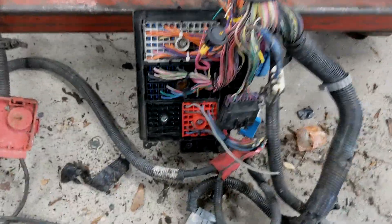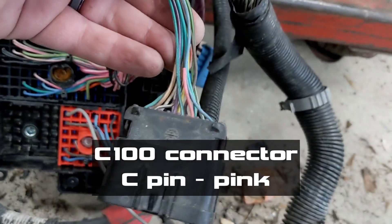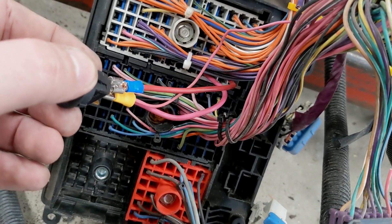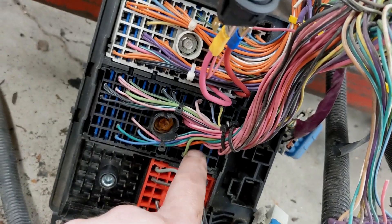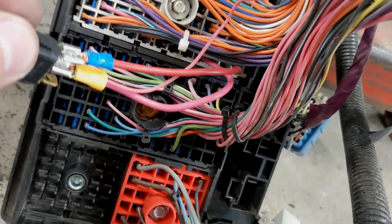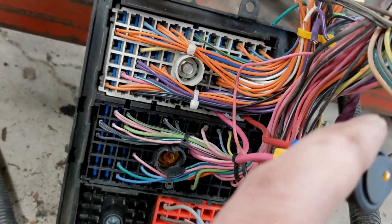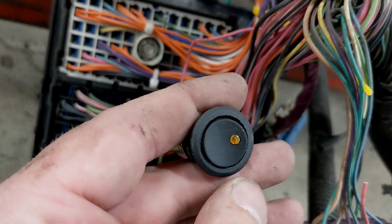So this is all the wiring you've got to do — it ain't tough. There's this pink wire in this connector; you cut that off and hook that to your ignition. You can do it for the electronic throttle control, that's what I did in the Beretta. Put an extra pin in here — it's B9 I think. I'll make sure that's right. Then you take the two heavy gauge wires: one battery constant and then the other ignition. This is battery constant that goes to the ignition switch in the truck, and then this is the one that comes back from the ignition switch in the truck. So here's my ignition switch now.